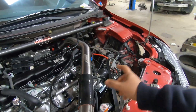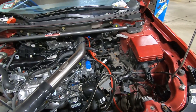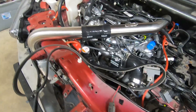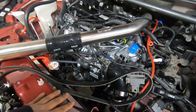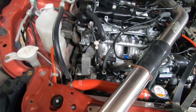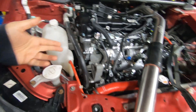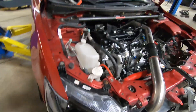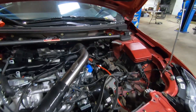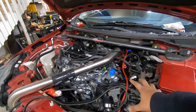The cam angle sensors and the MiVec look different, but the pinouts are the same. The crank sensor is in the back — we have to stretch that. There were some modifications needed on the starter. He wanted AC, and we wanted to give him the Evo X alternator which is much larger, so we had to modify a little bit of the hanger. The car does not have power steering, so the belt is different. There's a little bit of modification and trial and error needed. The motor mount needed to be adjusted as well.